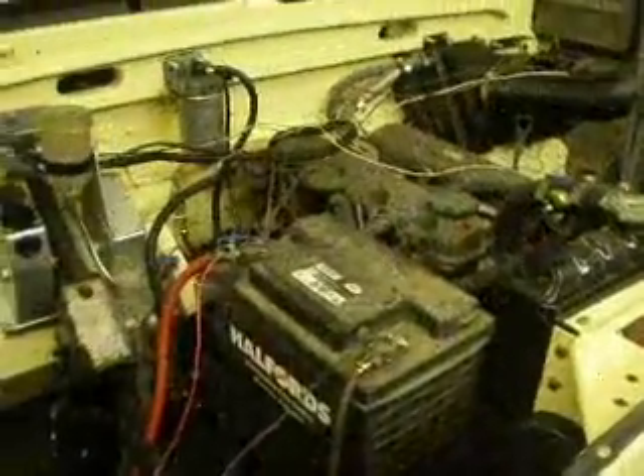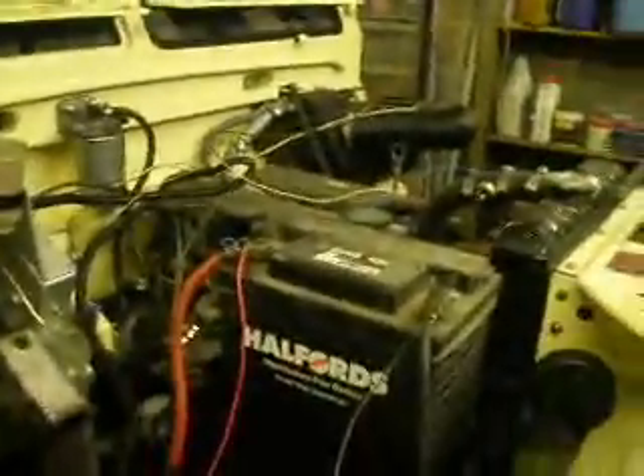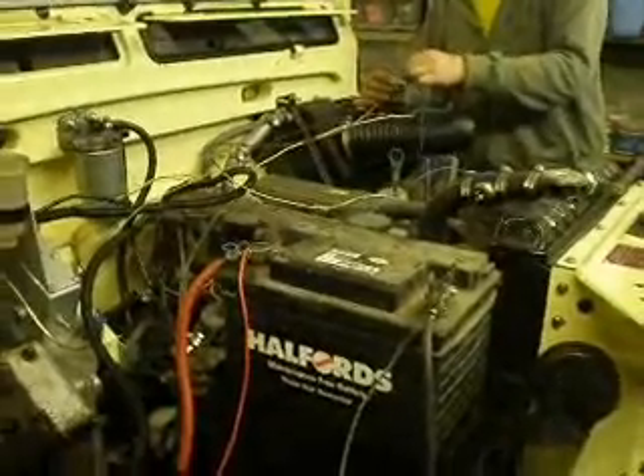So we're going to try in a few seconds and give it a go. Because I lashed it up, touched the wire and it did something. So I thought I might as well try and see if we can get it started. Just going to start a 200 TDI installed as a DI in my Series 3. First time it's been started in three years. I've had to prime the fuel right into the fuel filter. Here we go. Are you ready? This is a bit cannibalised just to test it.